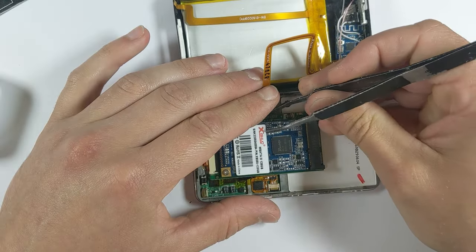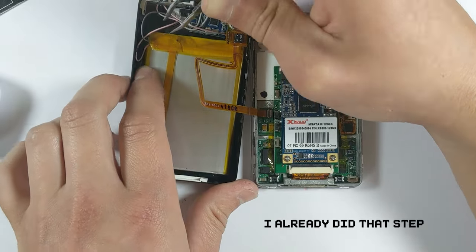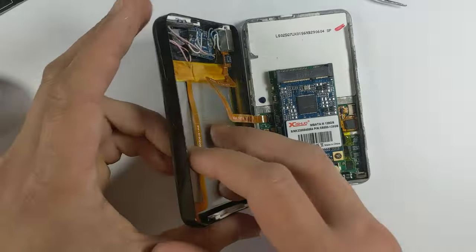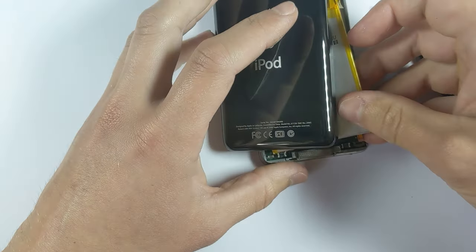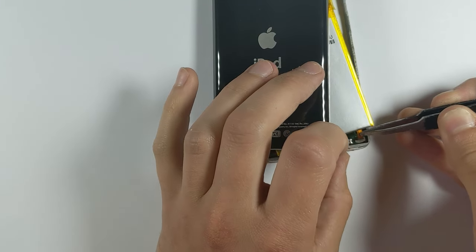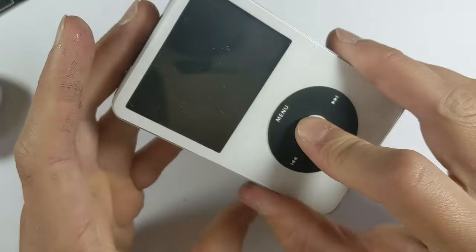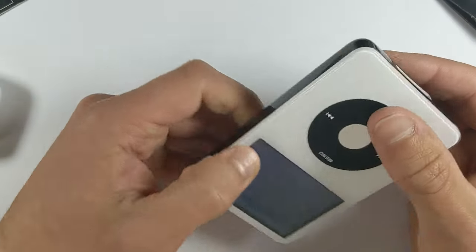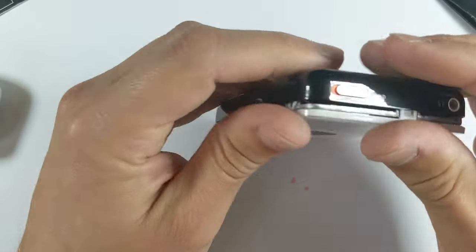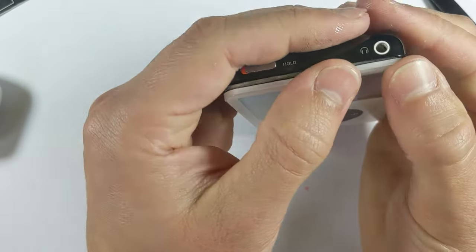So to seal this thing back up, first connect the headphone jack flex, then get all the excess wires and tuck them up from the top like this. Now install your hard drive or whatever storage you've decided to go with. Make sure your battery is facing the right direction, then you can plug in the flex cable to the motherboard. Make sure none of the wires will be sandwiched between your battery and the adapter, as that could cause clearance issues or even push against the back of the screen. Make sure your battery and adapter stay in the correct positions, then you can just snap it shut and all should be good.